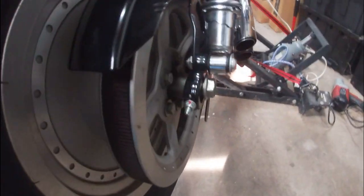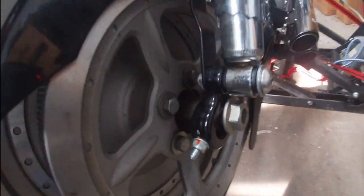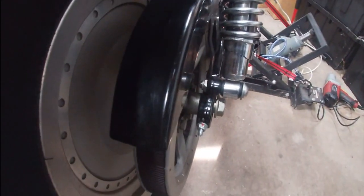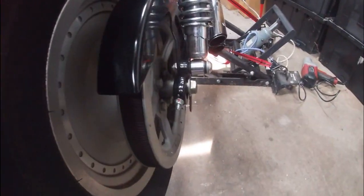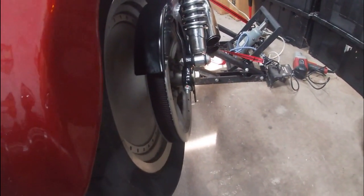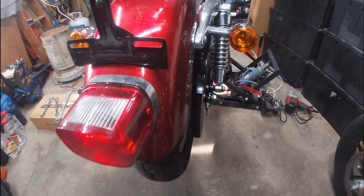You can see that nut is rounding off the torx head — it's not coming loose, it actually rounded out and destroyed my bit. They're not supposed to be that tight; they're only supposed to have blue Loctite and like 40–45 foot pounds. So I'm going to attempt to get the wheel out hopefully without catching the pulley on that nut and bolt. Once I get the wheel out of the way, I can work on getting that bolt out from the back side.